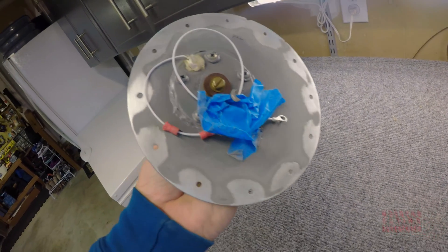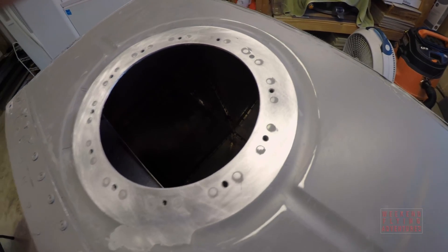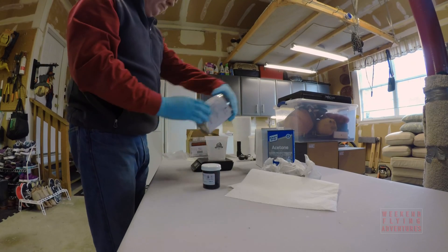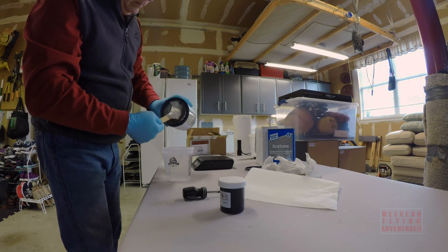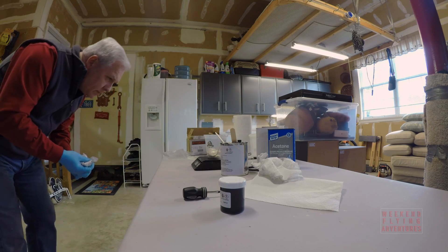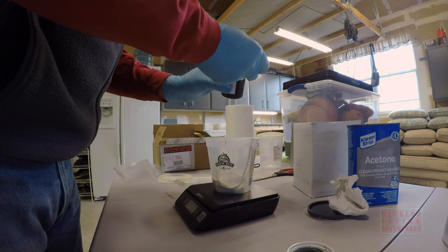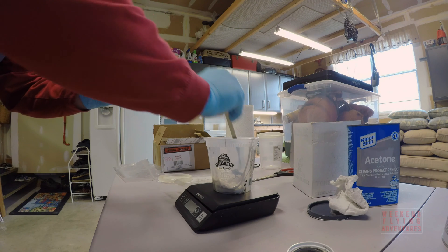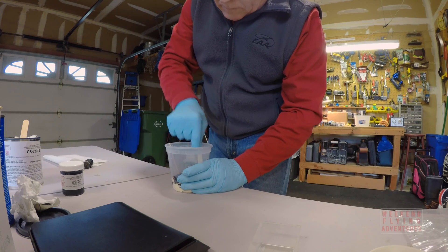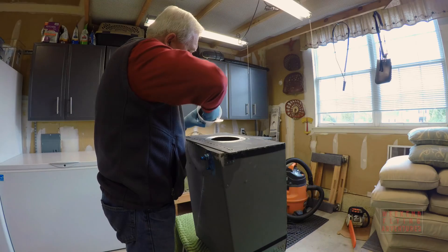I used fine sandpaper at the end to make sure every piece of old sealant had been removed. I ordered the sealant for the tank from the manufacturer, Vans. It's a two-part sealant mixed by weight in a 10 to 1 ratio, so you can see me going about that measuring here. It has to be thoroughly smooth and all of the activation agent has to be mixed really well with the other part.